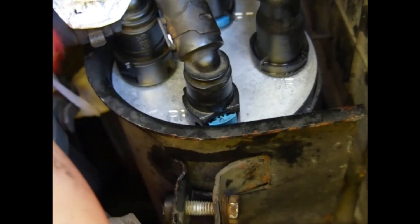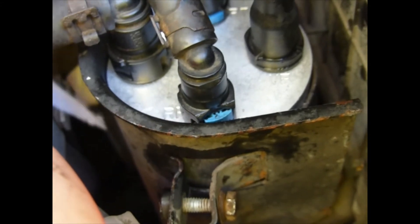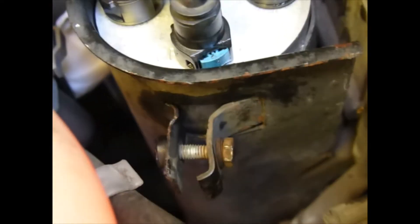The filter system is self-priming. Turn your ignition switch to the first setting — not switch on the engine, just to the first setting. You can hear the filter. Do that a few times — it's filling up the fuel filter.